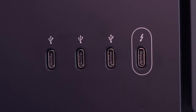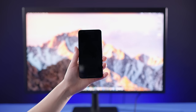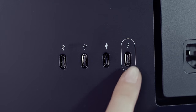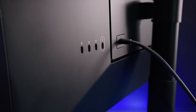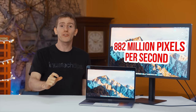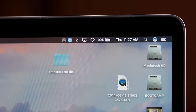A single port type rules the entire panel. Whether you like it or not, this is probably a window into the USB Type-C dominated future that we are headed for. These three are USB 3.1, 5 gigabit data ports, each capable of pushing 7.5 watts of power, so enough to charge your phone or other USB device. And this one, which is the only input on this monitor — that's right, just one — looks the same as the other ones but has far more going on under the hood. It's a Thunderbolt 3 input, which allows it to not only carry the data for those USB ports and the 882 million pixels per second from your machine to the display, but also to push 85 watts of power the other way, enough to charge your laptop.